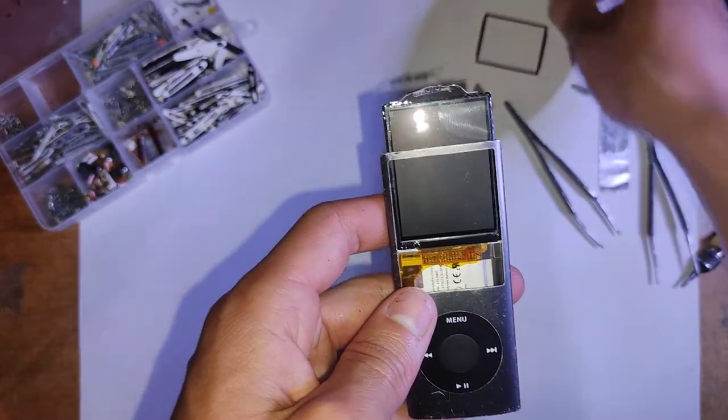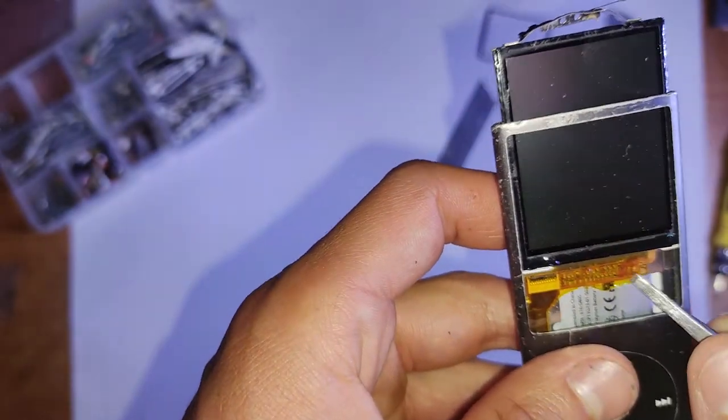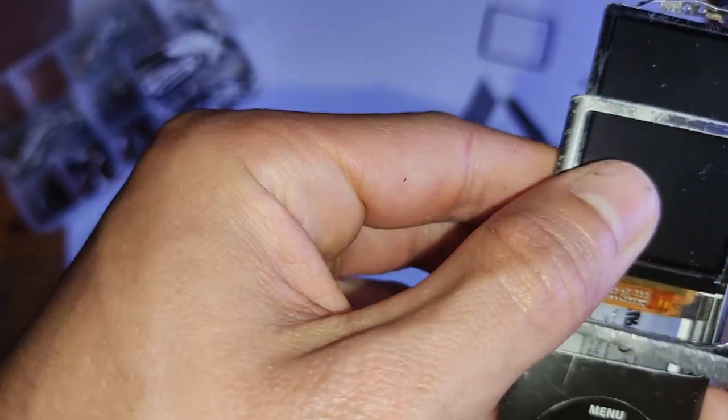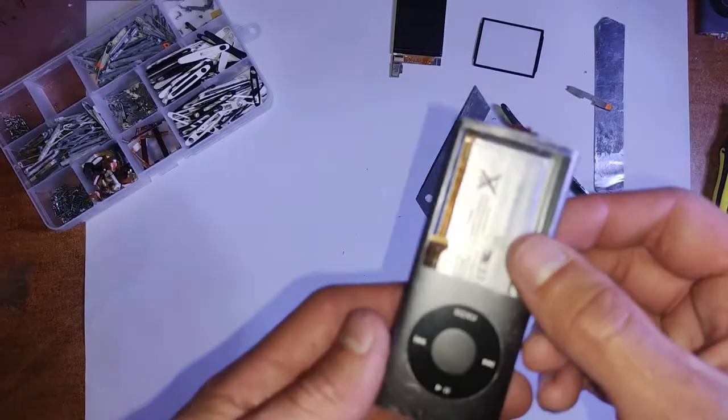Now, just to remove the LCD connector, just remove that cap and tape. Yeah, and this is the flex cable for the LCD I was talking about as well. That's infused into the logic board. Quite often it can break as well, because it's right in that position where water often gets in. So if you get a corroded backlight pad there, the whole thing's just dead. You have to throw it out basically. You can always try and run a wire, but that's a real last resort sort of thing, and it doesn't always work.